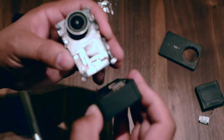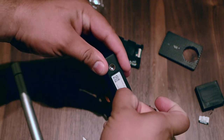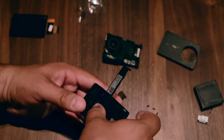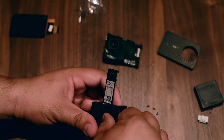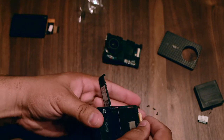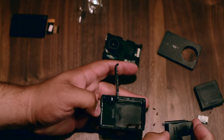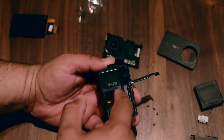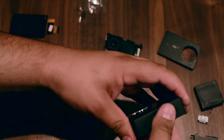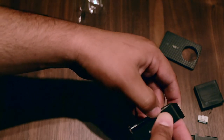We need to remove this one like that. Now we have the battery case which we need to remove again, and we have a screw right there. I take the last screw right here and now we're gonna just pull it up and remove the battery case. Carefully — it's really tight in. Now just push the screen out, just like that. It's on glue so just push it. Be careful not to cut yourself.